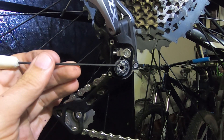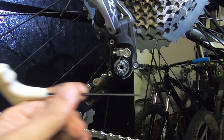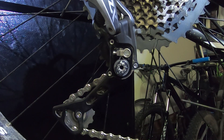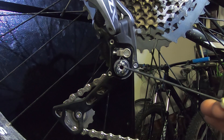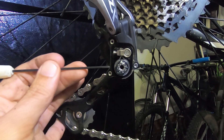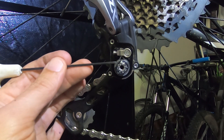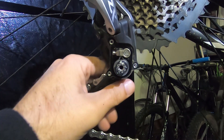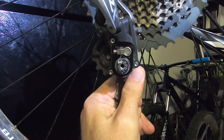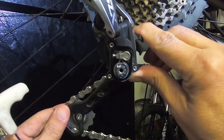Apparently on the Schwinn, it looks like this is one solid piece and therefore it's not directional. If you tighten it, you get resistance going forward and resistance going backwards — that's not a true clutch. On the video it doesn't confirm if that's the case. I posted that question on Kev's site and hopefully he'll answer whether there's an actual one-way bearing in there or not.